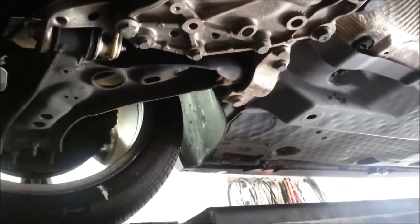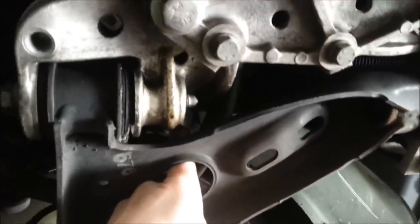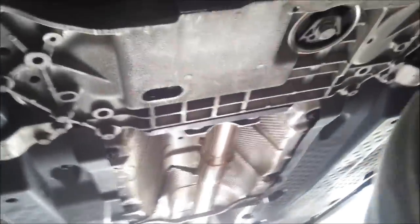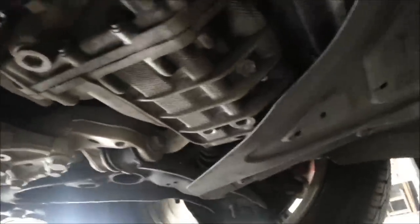Quick thing for the VDub guys: I've got a Mark VI and anything basically from a '99 on up — you're going to see a bolt here and a bolt up in there. You loosen that bolt and that bolt, do that on both sides, and then you can adjust your camber. That's how you're going to adjust your camber. It can be a little more tricky — you'll definitely need two people, a pry bar, and an alignment machine, so make sure you go to your shop for that. The toe adjustment was just back here — which is pretty easy, like a turnbuckle if you've worked on RC cars. Pretty easy.